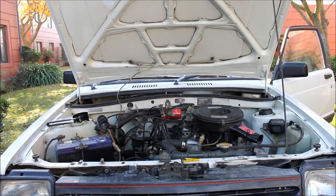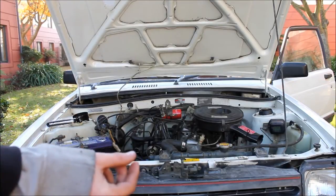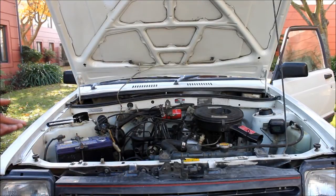It's built up oil pressure and it's running nicely now. I'll let it drain back down for the next 4 or 5 minutes and check the oil level again — I think I'll probably have to add a couple hundred mils. I usually run the dipstick about 2 or 3 millimetres over the full line. I'll set to doing the gearbox oil now and then we'll be pretty much done for the service.